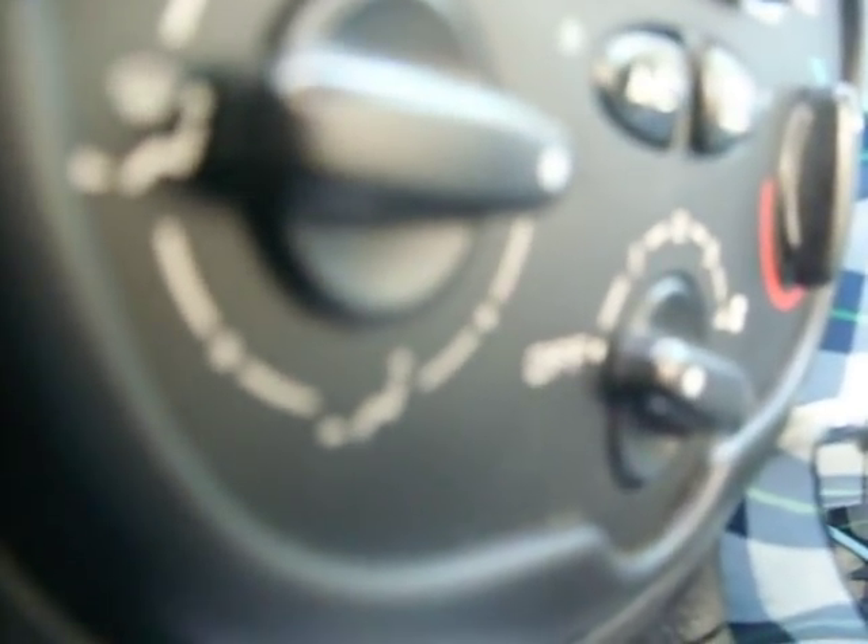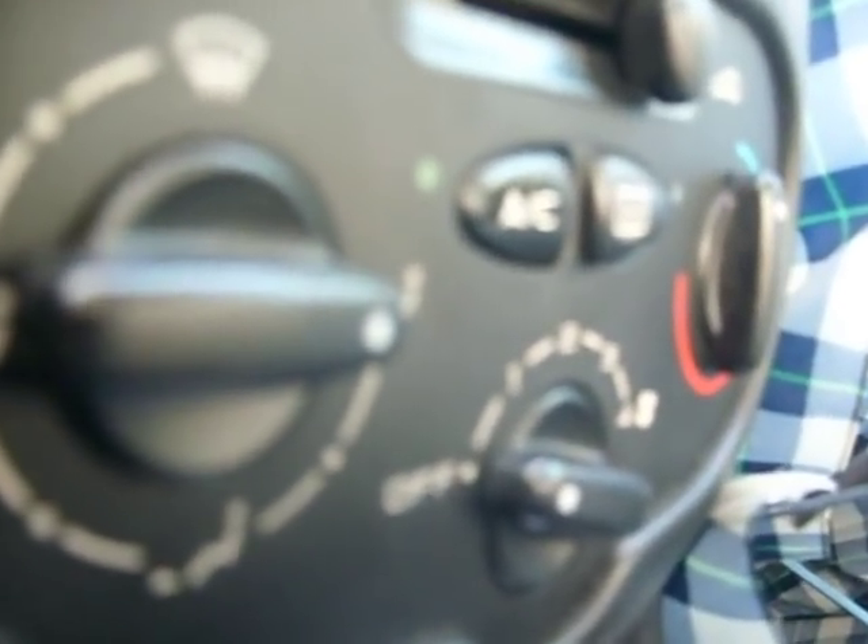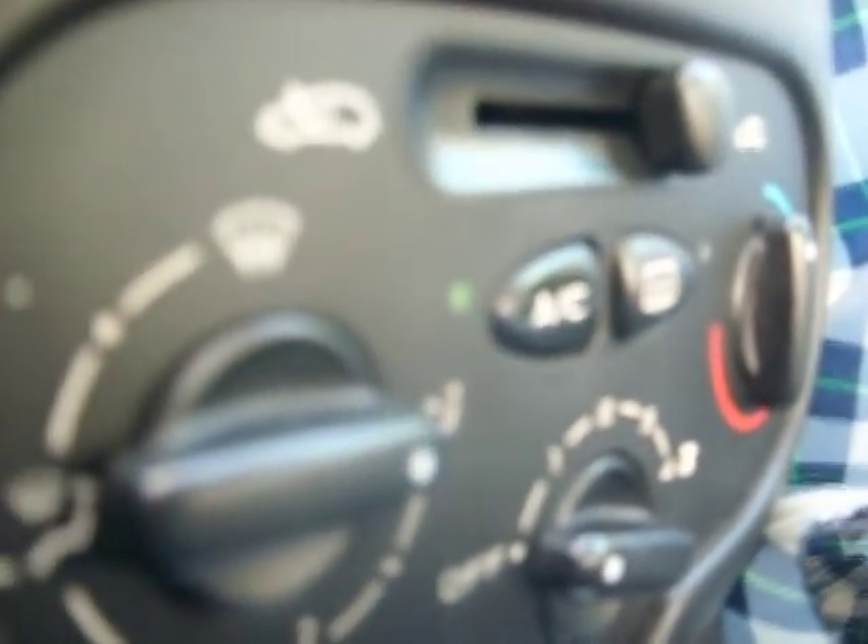But the main defect is not this. The main defect is this — I'm going to turn on the car. There's a noise — a clack-clack when the car is running. It's the gearbox. There's a clack-clack sound. When I open the clutch, the noise disappears. The car is smooth, but it accelerates. When I open the clutch at the dead point, I turn off the clack-clack — it's like a light tapping sound.